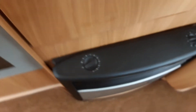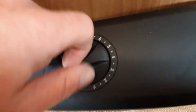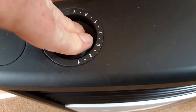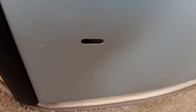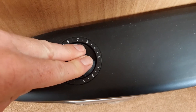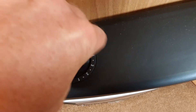You can also run the heating system on gas. Make sure the gas is turned on. Down the front you have a pilot light window. Turn the gas control switch to between 9 and 10, hold down the gas valve and continue to hold it. The igniter will kick in on its own and when ignited you'll get a pilot light in the window at the front. Once the pilot light appears, continue to hold the gas valve for a further 5 to 10 seconds, then slowly release it. You can then control the temperature on the dial on top.